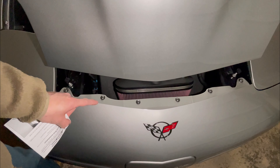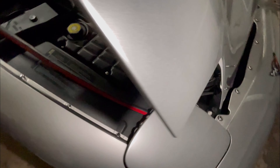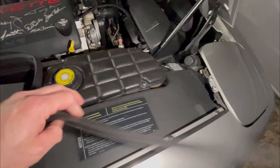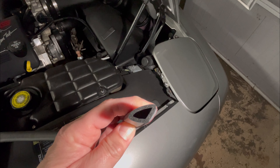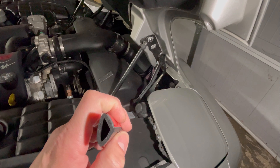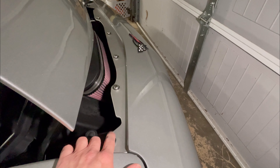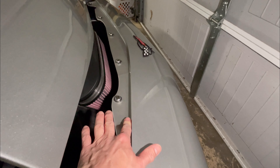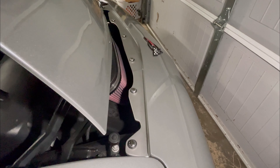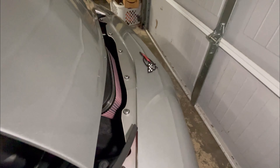All it is is a piece of weather strip, but this one conforms very nicely. We've already tested it dry. It comes with a little bit of adhesive on the bottom tape and it's a triangle-type shape. You want to butt the side with the adhesive down on the flat surface where the little push pins are, and you want it to run all the way down.